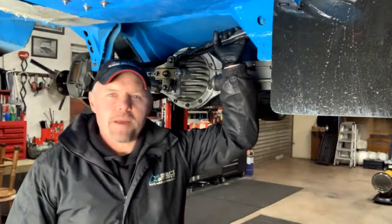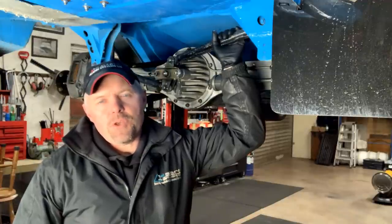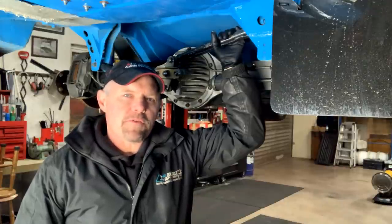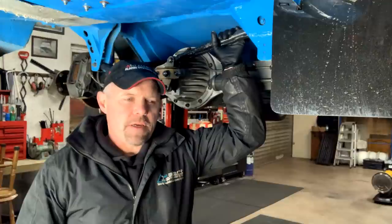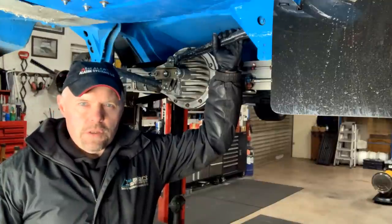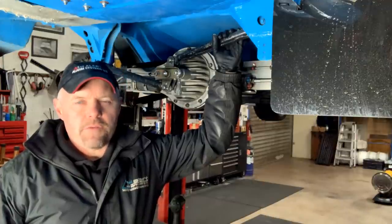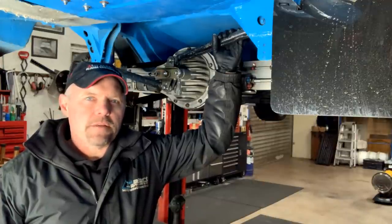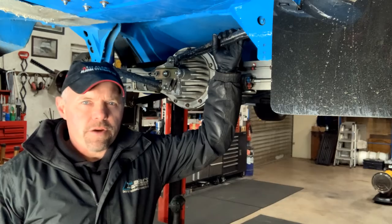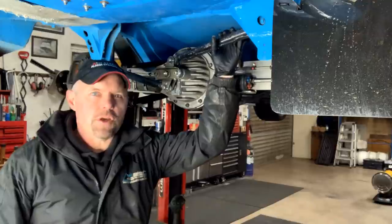Hello, my name is Frank Kelly. Welcome back to Kelly Motorsport Workshop. We're going to do a bit of work this evening on the diff. We're not doing anything rash - the diff doesn't really need a rebuild, but it's lost a bit of its preload. I did a bit of a test with a torque wrench the other day and we've only got about less than 20 foot pounds of torque out of the wheel. That's not always exactly what you get at the diff, but I think it's worth pulling it out to check. I've got a plate kit if I need it. The diff is relatively new since we've gone through events, but I'm just a bit concerned about how little preload we have. So I'm going to pull the diff out and show you how to get it out of an Atlas Axle.